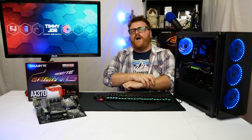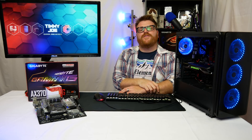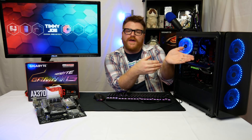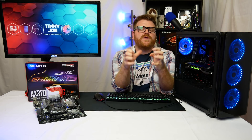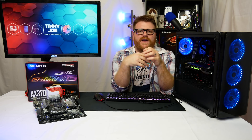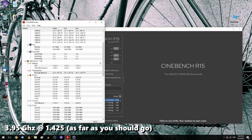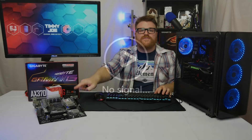As for CPU overclocking, I can get my chip to 3.975 GHz — almost 4 GHz — with a really good cooler. I usually run it at 3.975 GHz at 1.425V for maximum performance, or dial it back to keep fans quiet. But with this Enermax AIO I cannot get past 3.9 GHz on the Gigabyte x370 no matter what, which is actually worse overclocking performance than a board that's $45 cheaper.